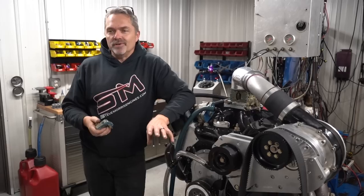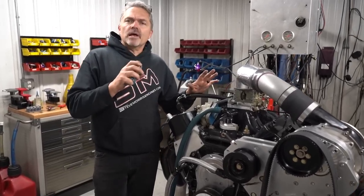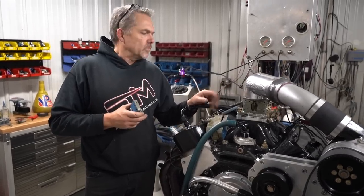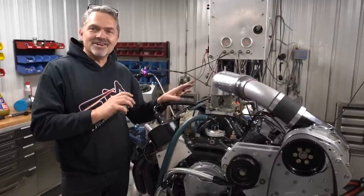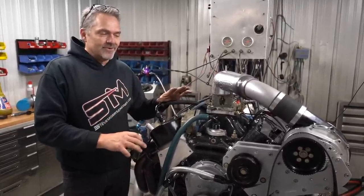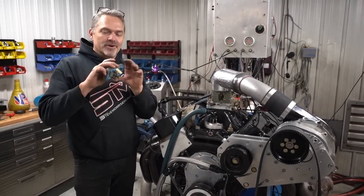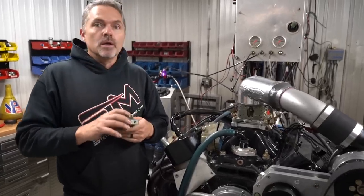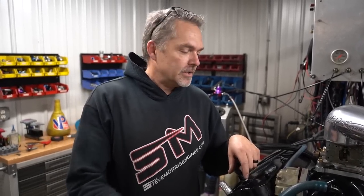So we're putting that pulley on, different belt, and I'm going through the carburetor because I also don't remember what all was going on with the carburetor. I mean, you're talking about something that's literally 12 years ago. And so I've got to resort the whole deal out. So we're working on jetting, fuel, and then taming the boost down, and then showing Kyle how all this works with the carburetor, boost reference, power valve, stuff like that. Tech for the day. Caution, you will learn something here. If you are a blow-through carburetor guy, I try to tell people this all the time, and we proved it out.